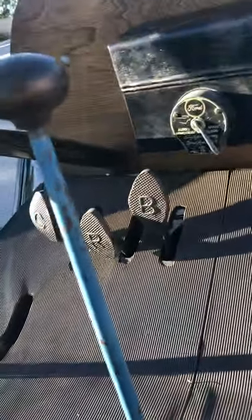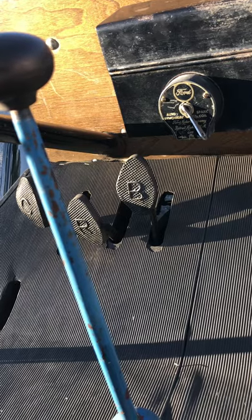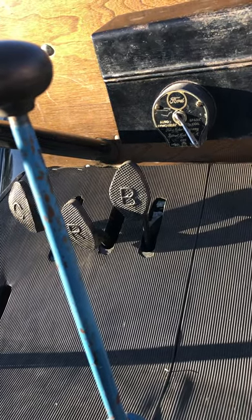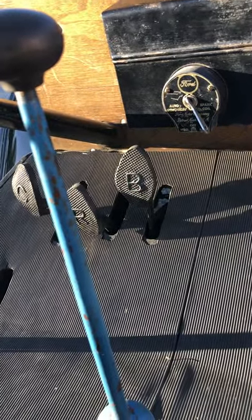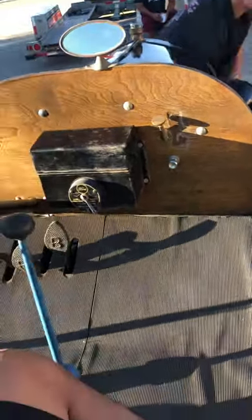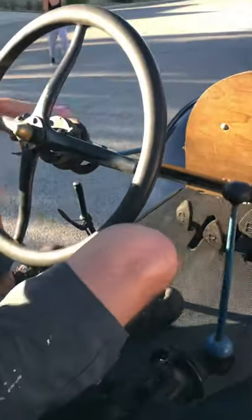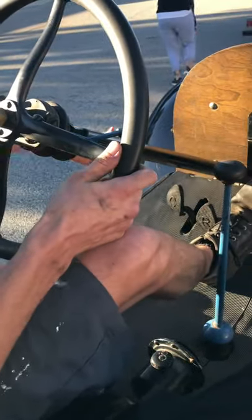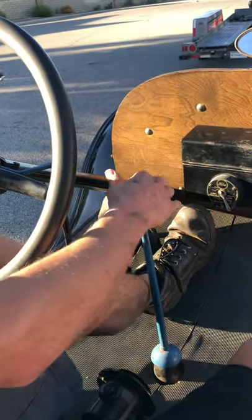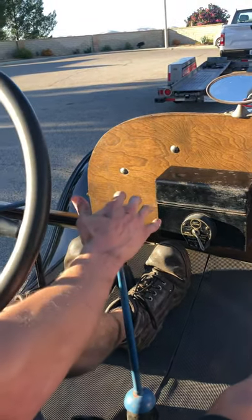So clicker over. Right now you don't hear anything because it's not on top dead center. If I stroke this up a little bit, it might fire on me. Hear it? Yeah, I thought I'd just hold my hand back because it actually fired whatever gas was in the cylinder. Since the clutch is already engaged, you push really hard on the brake — it actually slows down the cluster of these transmissions, so it allows you to put this into gear.